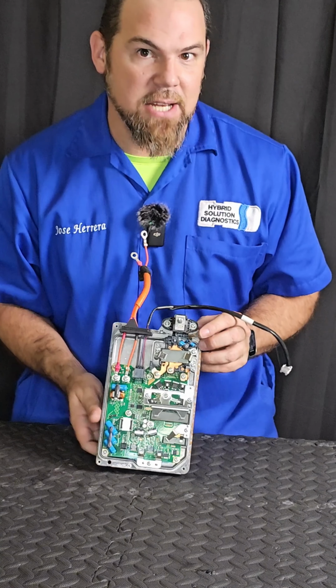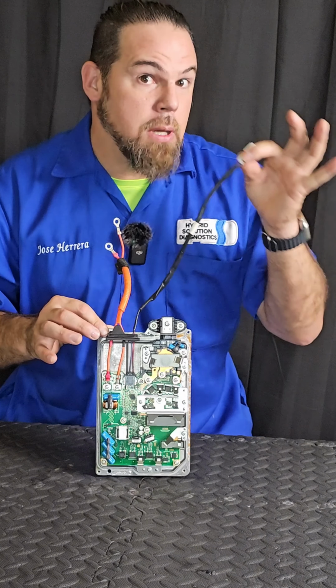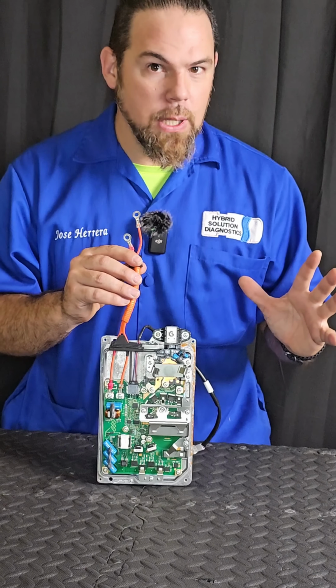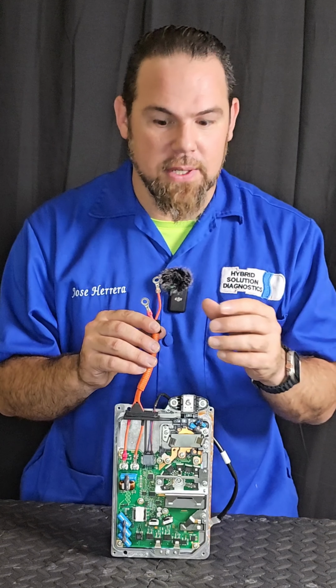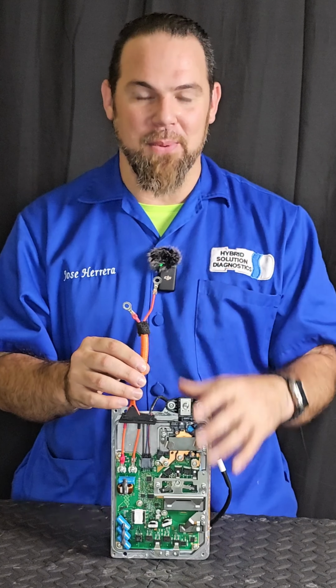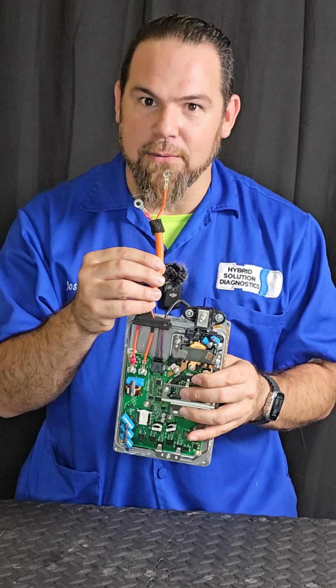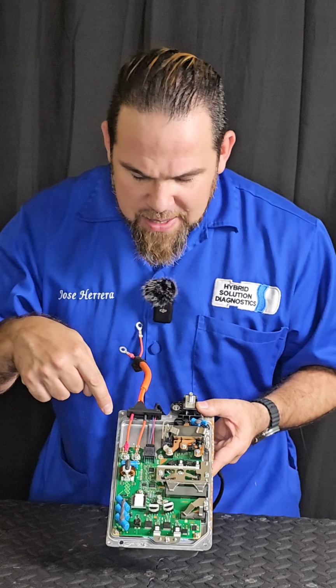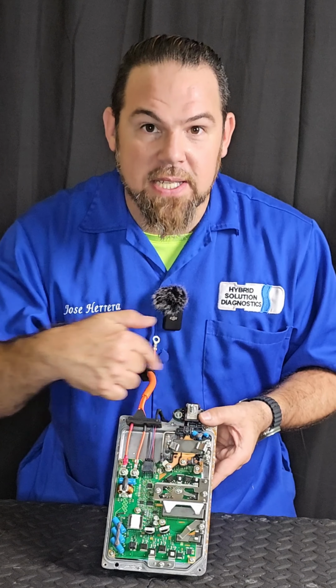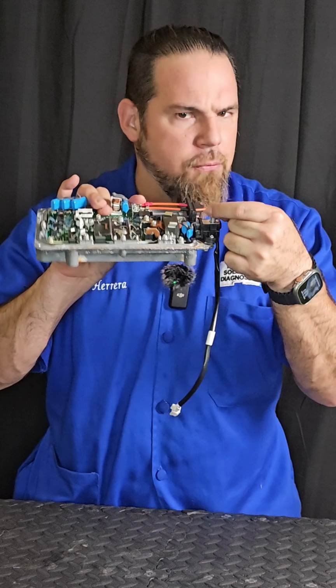This is actually very interesting because the first thing that we have is just power and ground, which we could say is our controller. And then absolutely all the power that feeds the onboard electrical system comes from these two tiny little cables. Now remember, they're orange because it's high voltage. Now then, if we're just receiving positive and negative high voltage, what is the process in here for us to deliver 14 volts?